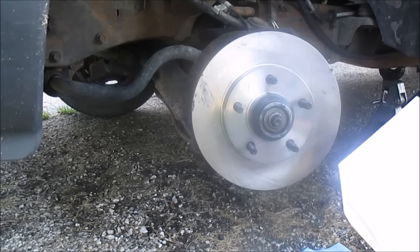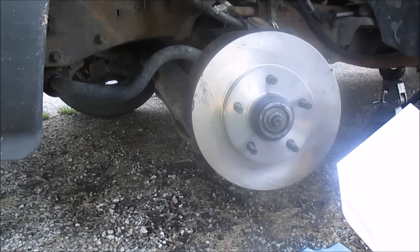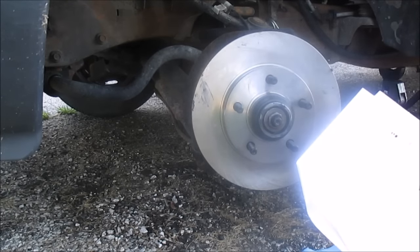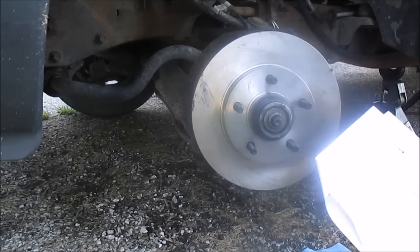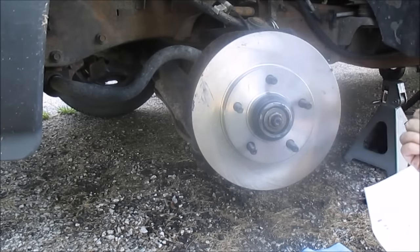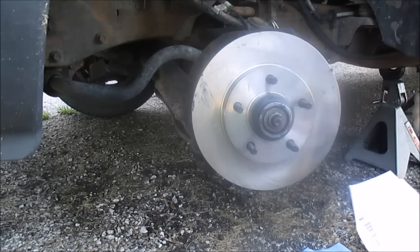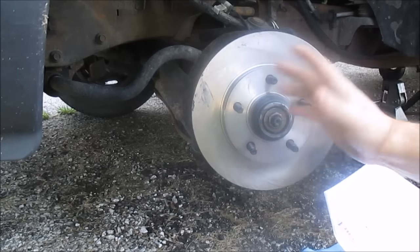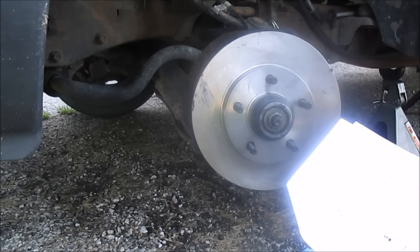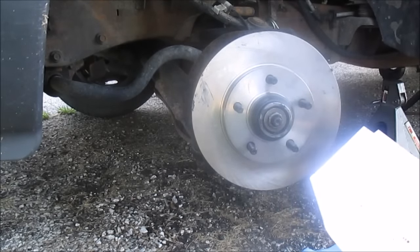Then it says you loosen the spindle nut two turns. Then you tighten the spindle nut while rotating it again to 17 to 24 foot-pounds. And then the last time you loosen it, it says 175 degrees. I'm just gonna go 180. And then your final torque, you go to 17 inch pounds, which is not very much. Inch pounds is very little.